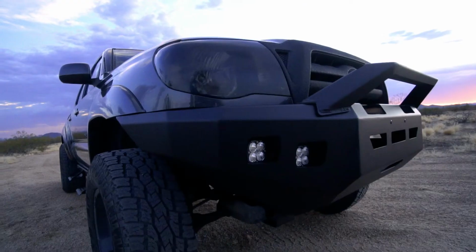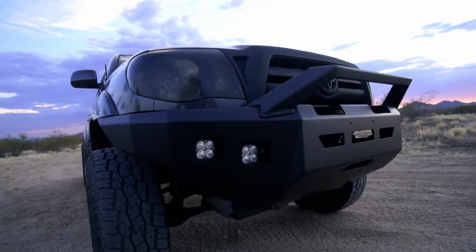So as you can see, we're finished. I hope your install went as easy as it did for us. Any wiring that you need to do, go ahead and finish that up. Any problems you run into, reach out to a professional to help you wire. Lights, we do those after this bumper's been installed. Like I said, you'll notice it was a lot easier to put it on without the lights installed, so go ahead and finish those up. Also remember to periodically check the hardware on this, and we recommend retorquing every 500 to 1,000 miles. This will reduce any problems you have in the future.